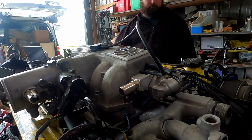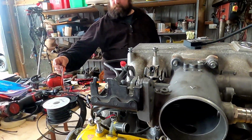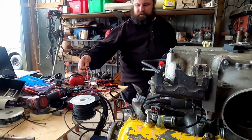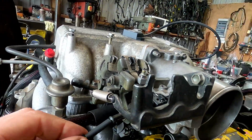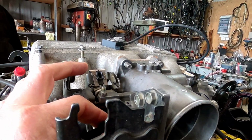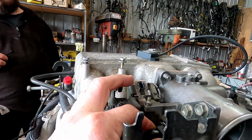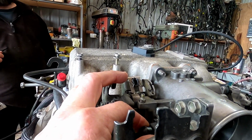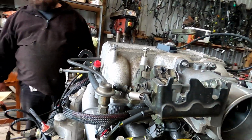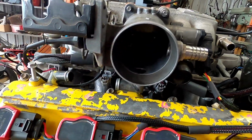So water temp sensor goes to that dash plug. Blue wire here. So from there, it's a blue white. Blue white. Good. Air temp, you've just got the Bosch plug. Yep. Was there an air temp in the box? Yeah, that was the plug that was in the box. Cool. Oh, no, actually I think there was an air temp in the box, so it can be mounted like ours, or it can be mounted in the intake pipe. Yeah, he's got.